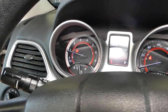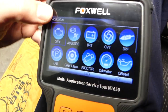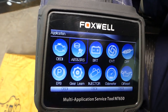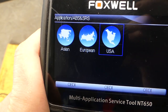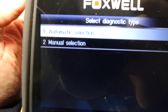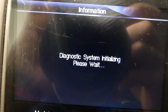I'll turn the car off, or we can let it run while we diagnose so we don't drain the battery, since it's been sitting for a while. We'll use the scanner — select SRS, which is the airbag function. This is a USA vehicle made by Chrysler, so Chrysler, Dodge, and Jeep are all made by Chrysler. We select automatic selection, click enter, and it decodes the VIN number to tell us the year, model, and all that.